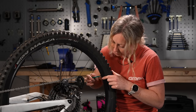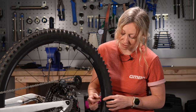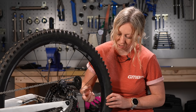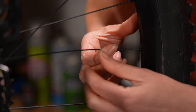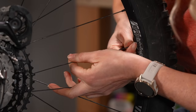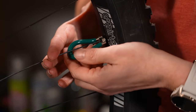That will at least stop the nipple from falling into the rim and should get you back home. If you've got a loose spoke where the nipple is almost all the way off and you can't even get a key onto it yet, don't worry — you can just manipulate it out and use your fingers to wind it. Remember you're going clockwise as you're looking down at it, and wind it onto the spoke until you can see it better and put a key onto it.